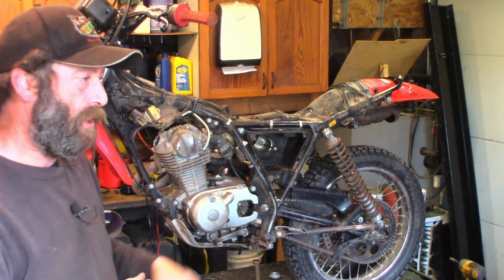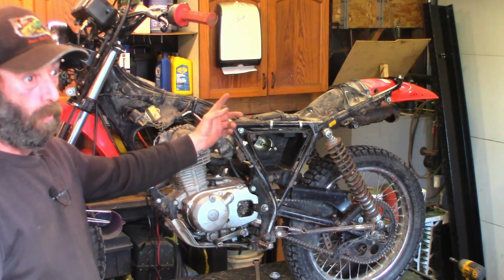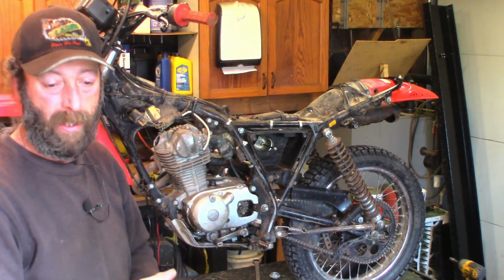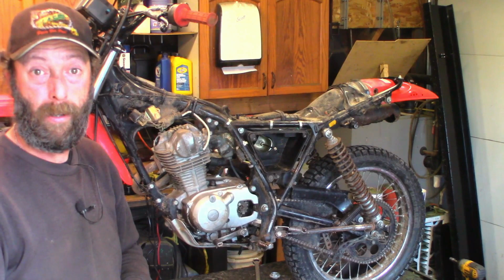So to do it the other way, like I was doing, turn the engine over till one valve is all the way down, that pretty well guarantees the other one is all the way up. So I'm just doing it by feel just to check, see where we're starting at, but I'll time it properly according to the manual, which I gotta find and read. Be right back.